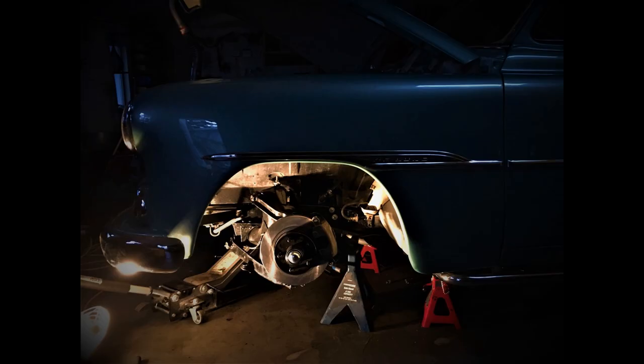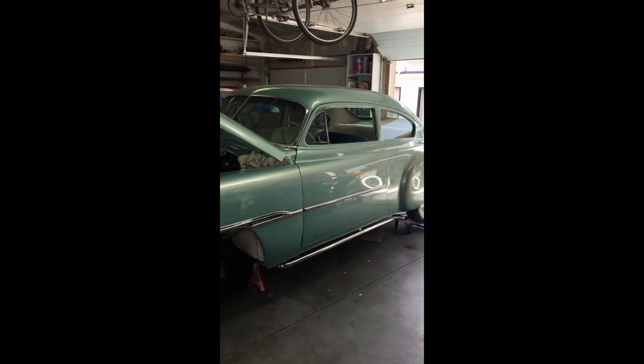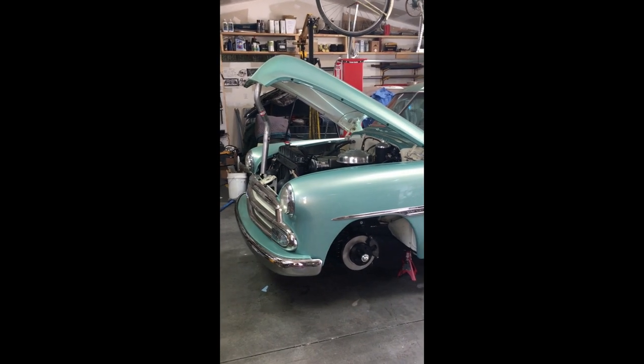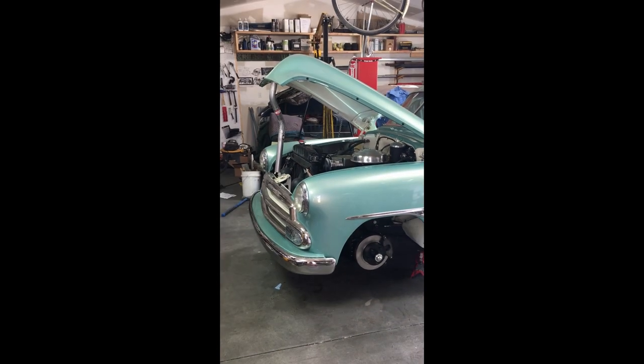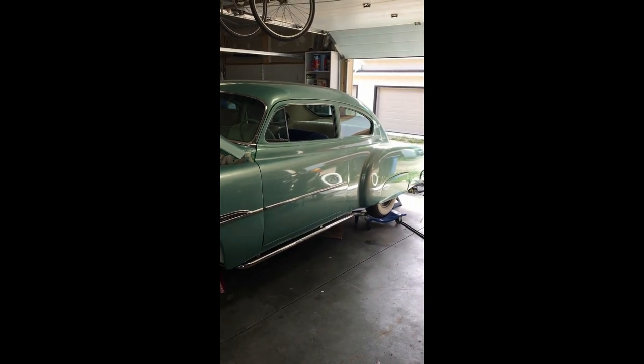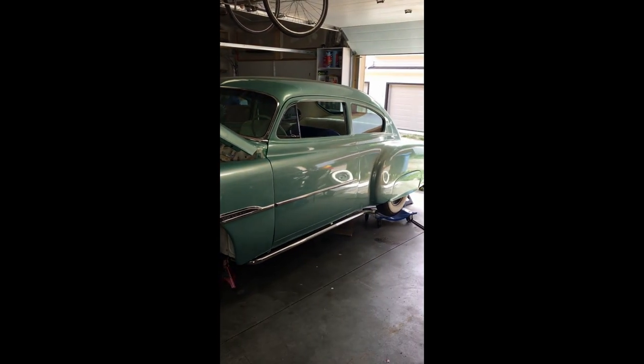I've got a shot here of everything installed ready for mock-up, and I had very minimal fitting to do. There was just a little bit of a curve that needed to be addressed with a file, and really it was more about the thickness of the paint I needed to get rid of. Here's a fancy shot with the work light underneath trying to highlight what's going on under the car. I just wanted to show that even while idling with the power steering pump installed, there were no weird whirring sounds, nothing unusual going on. Once I got it on the ground, the steering was very light yet had a road feel to it — all because of that reduced pressure.